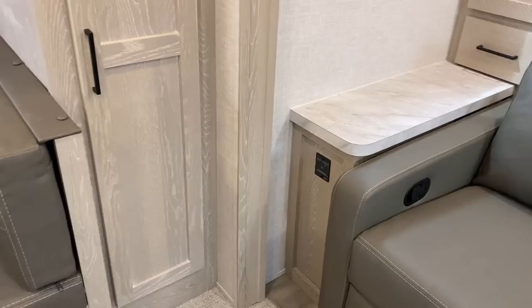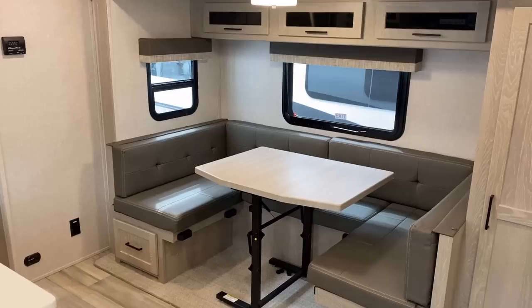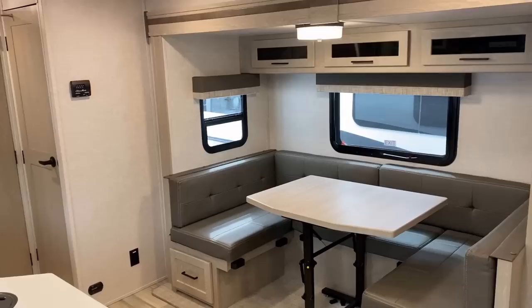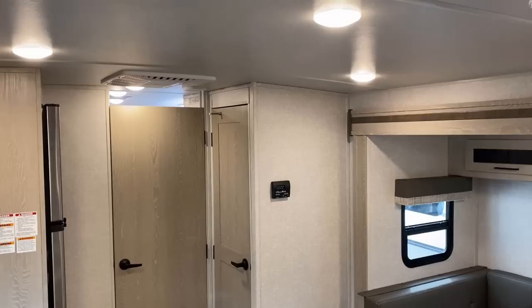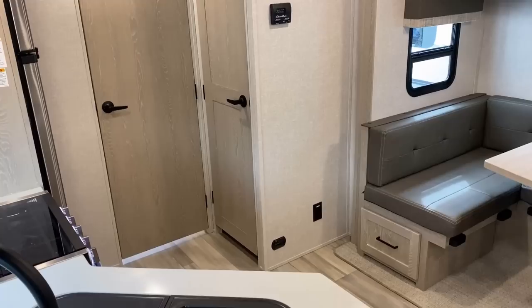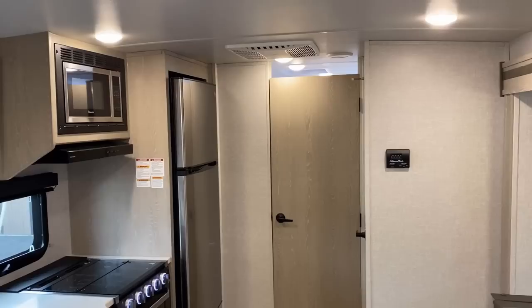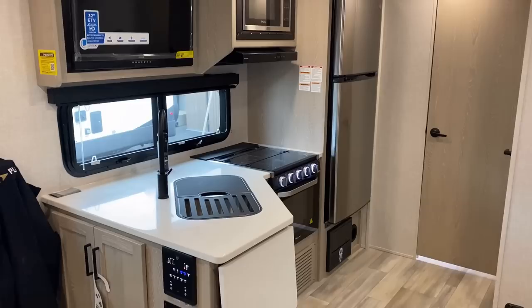This little switch — that black box with the green light on it — is the switch for the onboard inverter. Multiple outlets in this RV are going to be labeled with inverter circuit. If you are off grid, if you don't have a generator or park power, the only power you have is coming off the battery. There is a solar package helping charge the battery. Solar doesn't operate anything in the RV — solar charges the battery, that's truly mostly what it does. There are some advanced charge controllers that can provide some limited on-demand function for things like lights, but basically solar packages don't do anything other than charge the battery.